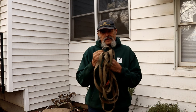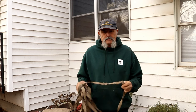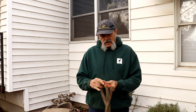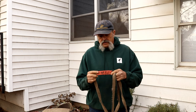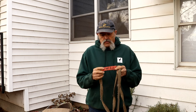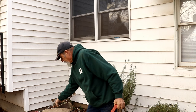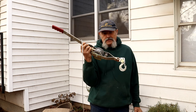Once a strap gets any kind of nick in it, as far as work goes I can no longer use it. You can't pick something up with a crane with this strap — you'd get somebody killed doing that. But as far as pulling rocks, I can look right here and it tells me that this thing set up in a basket — just a U-shape — will pick up 6,400 pounds.